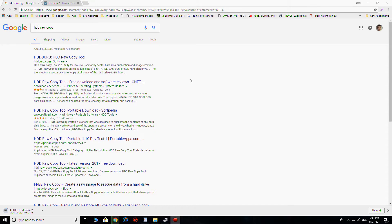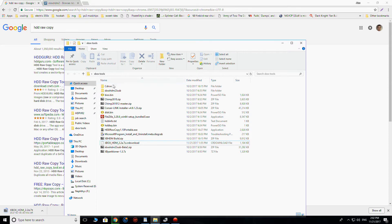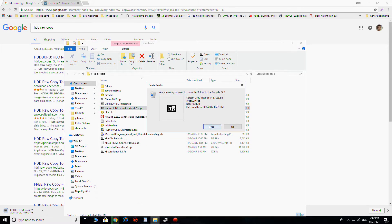In this part we're going to download a tool called HDD Raw Copy. This tool is going to allow you to clone the hard drives. I'm also going to provide a folder in Drive containing all the tools you need — specifically Xbox HDM 2.3, which is the file we're going to use to partition the hard drive and help with resizing as well. It's a very important program that makes it a lot easier so you don't have to use a PATA cable. Also in there is Chimp, for those of you who want to use it to clone your hard drive. In this particular tutorial I'm not going to go over Chimp, but I'm including it in the files just in case you need it. Xbox HDM is going to take care of that.